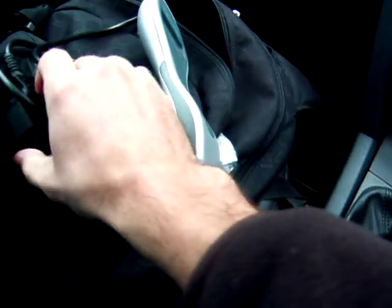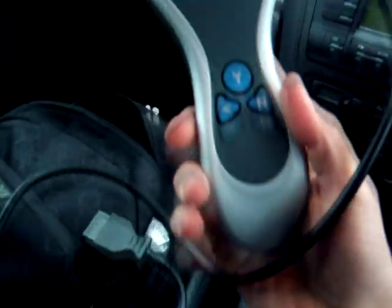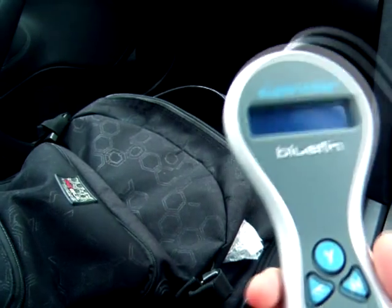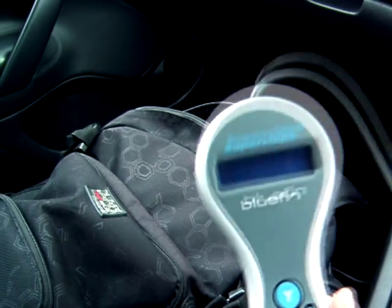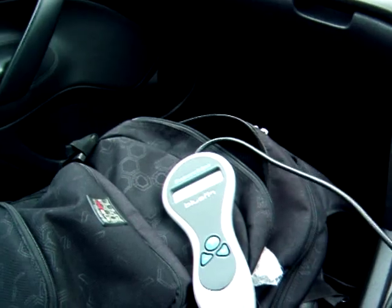Okay, so that's not taking very long at all actually. That took a few minutes to install the software, a few minutes to connect the device, and it uploaded the ECU on it. And basically I sent that up and within a minute I had a new map back. So we're going to upload that now because that was put onto the handset. That's ready now to upload.